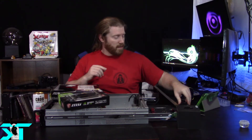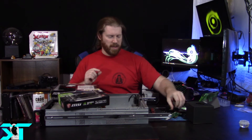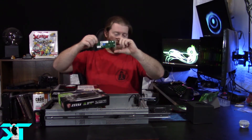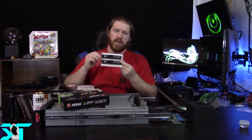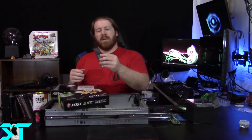That's the cooler for the processor. I got an AMD Ryzen 5 1600 AF - it's basically the 2600 model version just relabeled as the AF version. The box cooler will fit just fine, it's gonna be close though. For networking you need at least two NICs for this kind of thing, and I got an Intel NIC with the short riser card already installed. I've got 8GB Patriot dual sticks, DDR4 2666 - nothing too fast, it's a router, not a gaming machine.